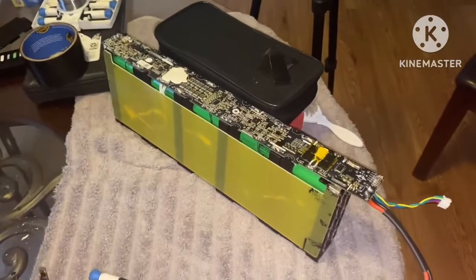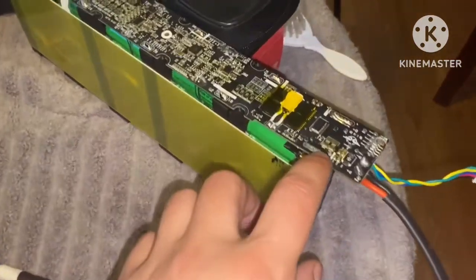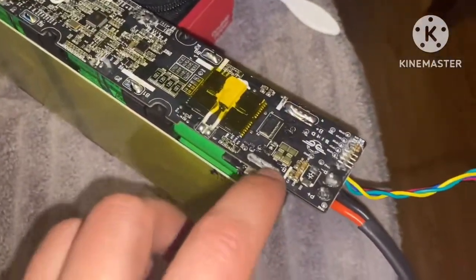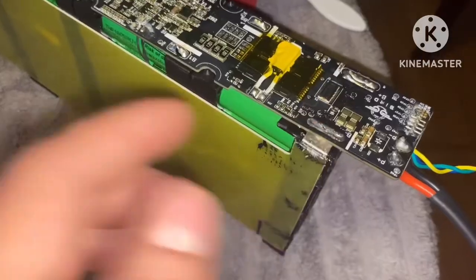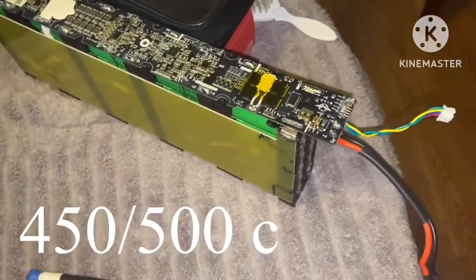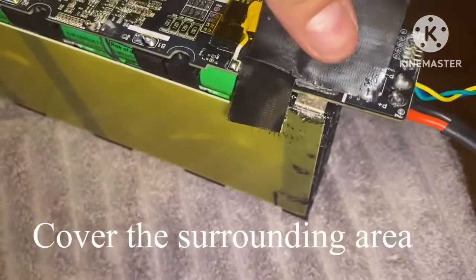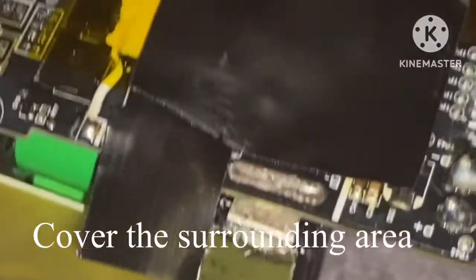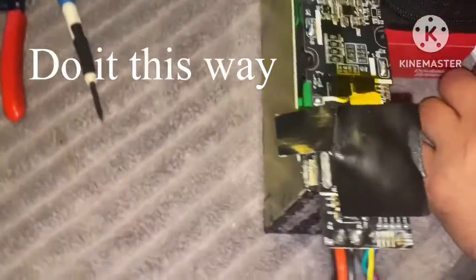I want to save your battery pack without breaking it down. What you're going to do is look at your B-plus and P-plus contacts — stick with the B-plus side. Get your soldering gun very hot, set it to about 450 degrees, and go over your contact points just like that. I used a brush —